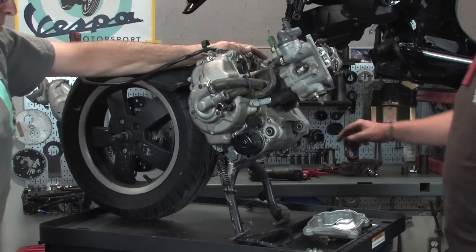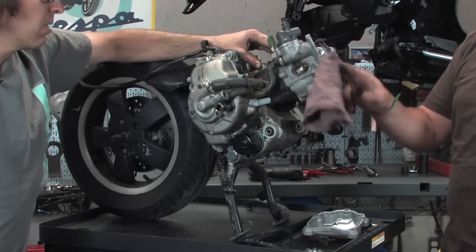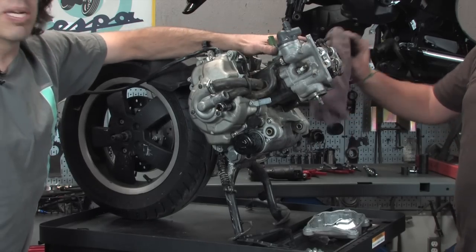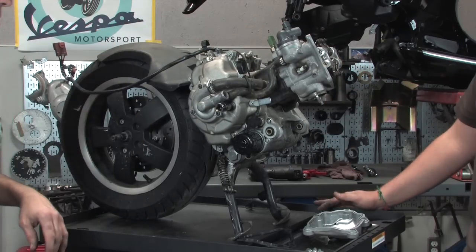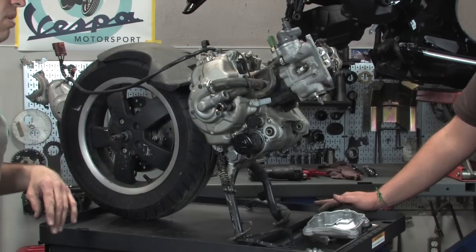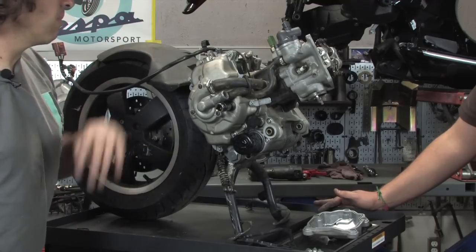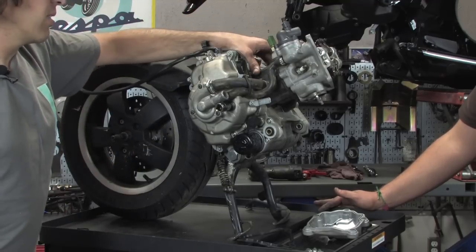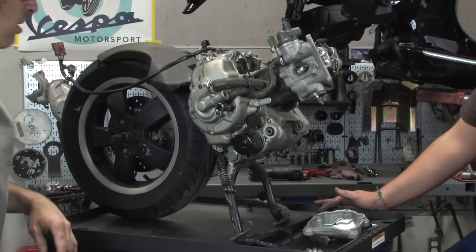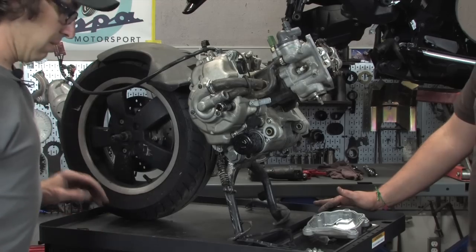And again, that liquid was because the water pump failed, and the whole cylinder filled up with a mixture of coolant and water. What happens is the aluminum is prone to warping when it gets to a very high temperature, beyond its normal operating temperatures. When these motors overheat, they generally warp the head and also sometimes score the cylinder pretty good. Hence why we're replacing these two top end components.